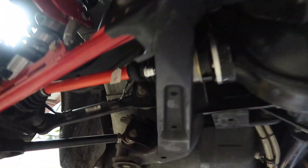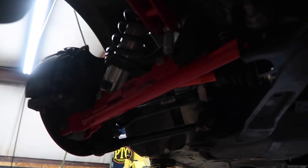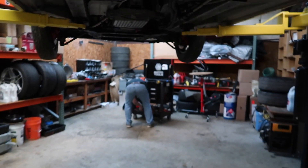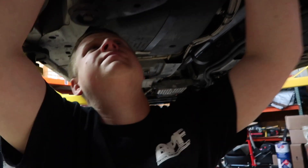Visual inspection — everything looks intact. I left this little tag on there for good luck and it let me down. In a matter of seconds we got both axles free from the diff side. This 9-inch here does hold in pretty strong. We just put those new axle stubs in there. In five minutes Ben already had both axles out. This one right here — I think this is the one that failed us. We'll know as soon as we get it off because it'll be all bound up. Surprised it's not taking the boots out though.